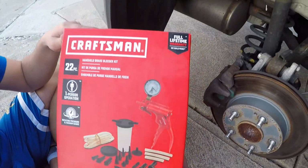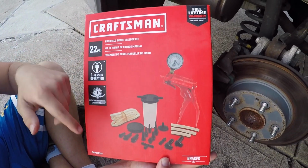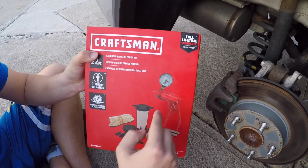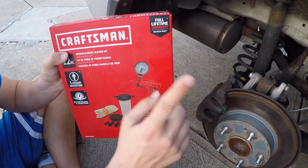To bleed it, there are many different methods. This is what I'm going to use. It's just a fancy gizmo I got from Lowe's. I'll include it in the description below. Basically, I'm just making a vacuum and it's sucking the fluid into this little reservoir, and you'll be able to see the difference between the new and the old fluid. So I'll go ahead and unpackage this, hook it up, then we'll get going.